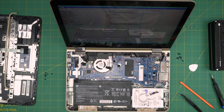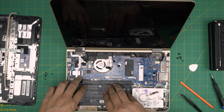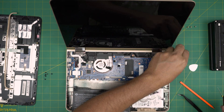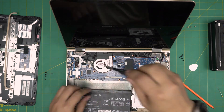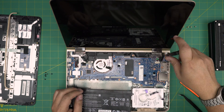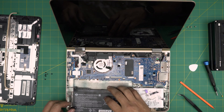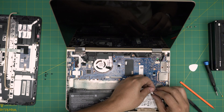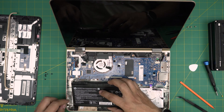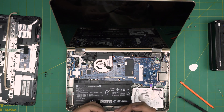Power it off and remove the battery again — lift from the back side and bring it back. Now put all the motherboard screws back in, starting at the corner by the battery. Once all the motherboard screws are in, plug in the flex cable for the hard drive and close it down. Put the back end of the battery down first, drop it down, squeeze it in place, and put all the screws back that you removed from the battery.